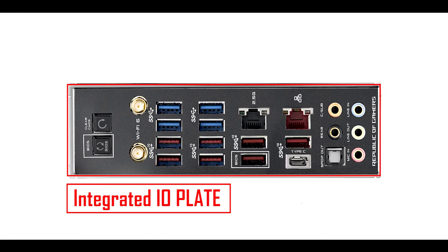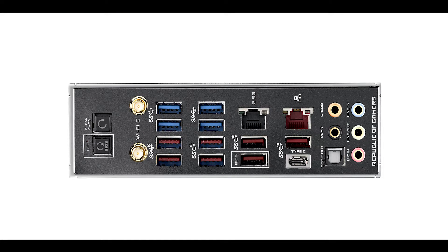On I/O, the first thing to note is the presence of an integrated IO shield, which is always a good thing, especially for first-time builders. You'll also note the absence of any integrated display port, and that's a good thing — it avails more phases in the VRM to give to our CPU for overclocking. Let's face it, if you're buying a Crosshair 8 Hero, you're not going to use integrated graphics — you'll have a 1080 or 2080 or whatever. Kudos to ASUS for some clear design maturity.